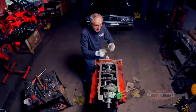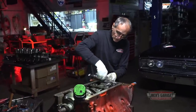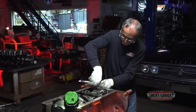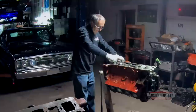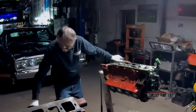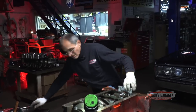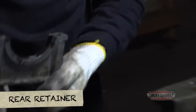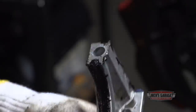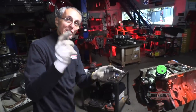The rear seal requires a 3/8, 12-point socket — special bolts. There's the rear retainer. Wow — this is a no-no: somebody put a rear seal with a lot of silicone on the back. You want to put seals on the ends and sides, but never where the actual seal is. We'll take care of that later.